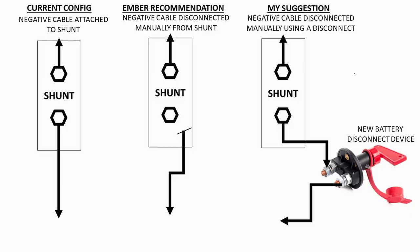I don't find that really acceptable for my circumstances. What I theorized — and drew up a diagram on — is you can put a cutoff switch inline, further along the circuit. The issue is that the existing battery cutoff switch doesn't actually cut off the battery entirely; it only disconnects most of the trailer but still leaves the solar panels connected to the battery through the charging system. My theory was: why not add a battery disconnect switch closer to the batteries? I took my plans to Woody's, they said bring it in, and they started ordering parts. They even cut a hole in the basement area of the trailer in preparation.